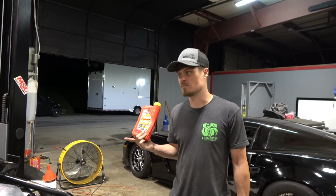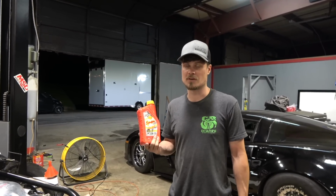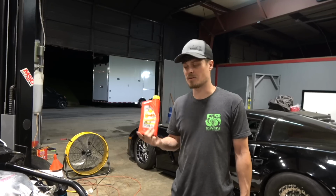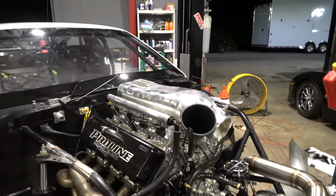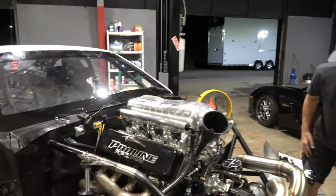We only really need to cap one, because normally the cooler line for the thing, one's blocked off because it's got a pressure sensor in it, and the other one's the dump valve. So we're good there. We'll get it filled up with fluids here, make sure there's no leaks, nothing like that, and then we will start the crank up process.